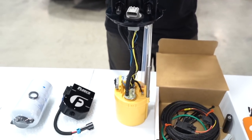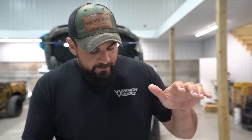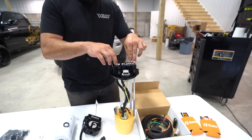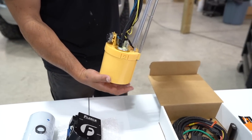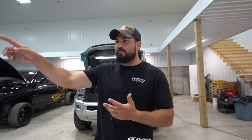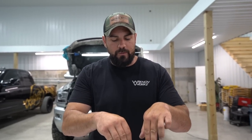This is their in-tank pump. So with this in-tank lift pump, we do not need to drill a hole for a sump. We don't need to mount anything on the frame. I still love everything else that we use on these fourth gen trucks — I'm not a huge fan of putting sumps on them and not that you need to. But this Fleece Power Flow pump is super, super sweet. It is drop-in, ready to handle a lot of power. We've got two pumps down here. All the fuel basically comes in through the bottom here for your low fuel pickup. I have one on the '15, one on the '18 — they have been awesome, super quiet. So we're going to use this as the heart of our low-pressure fuel system.